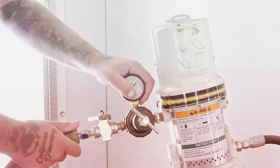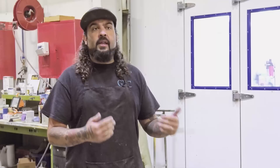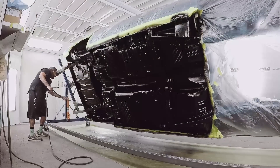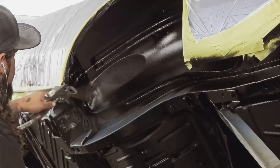We've already done the paint work, the cutting buff is done, it's all been washed up and completely spotless now. Now is the time where we go in, mask the car up completely, and start the undercoat process. Not every car gets undercoated — the ones that we do are factory done already, so we just make sure we always replicate that. It's nice to have it on there because it does quiet the noise down a little bit. I don't put it on as heavy as the factory does — I like it to look a little cleaner so you can see the quality of repairs we've done. It's a quick process, prevents the underside of the car getting beat up. The undercoating is a very quick process — once the car is masked up, you just spray. The most important thing is to make sure you get in all the cracks and crevices. It takes about 20 minutes to do, and it does take a good week or two to fully dry.